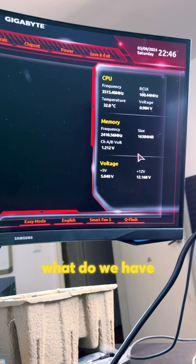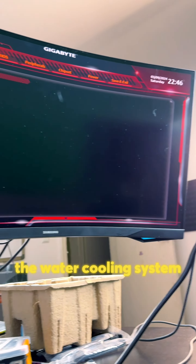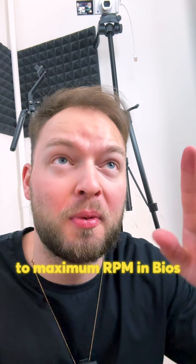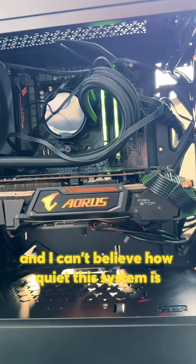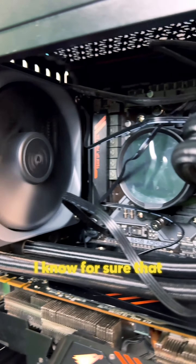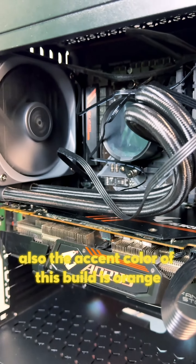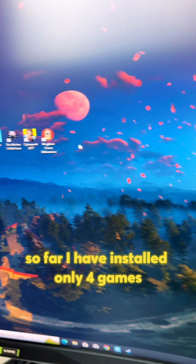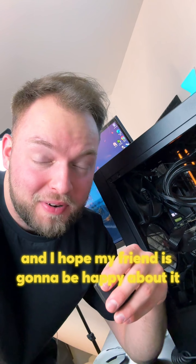What do we have? 16 gigs of RAM, CPU temperature 32 degrees — I think this cooler is working. Actually, this motherboard doesn't support the water cooling system directly, so I literally plugged the pump into the CPU fan header, and it's recommended to set that fan to maximum RPM in BIOS. I found that setting and changed it to full speed. I can't believe how quiet this system is. I've installed the drivers and a couple of games, and the PC works just fine. The water cooling is confirmed working because CPU temperatures never went beyond 55 degrees. The accent color of this build is orange, and I've managed to set the HyperX RAM to orange as well, just like the GPU. I've installed four games and will test them tomorrow. Even though it was a bumpy road, I really enjoyed building this PC and I hope my friend is going to be happy about it.